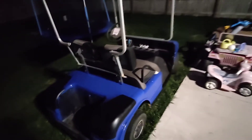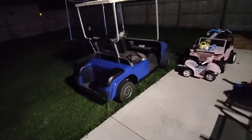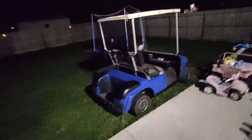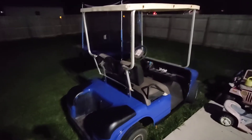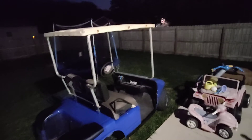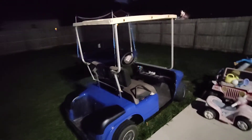I had to remove the shunt-based motor because I don't have a controller that would work with it, so I ended up buying an EZGO 6 horsepower motor that would be compatible with a series controller like my Altrax. I just happened to have one sitting around because I don't actually use it on my lawnmower conversion anymore. So really the only pieces I've had to buy were the frame for $300, this top piece, and the motor. I'm all in maybe $800, $900 at this point.